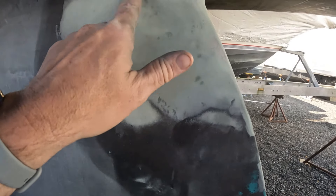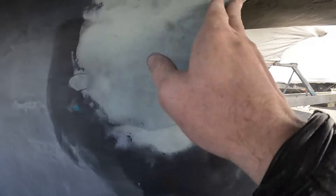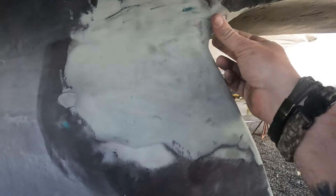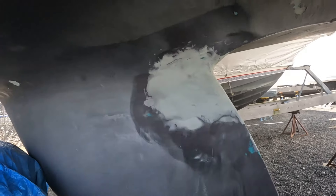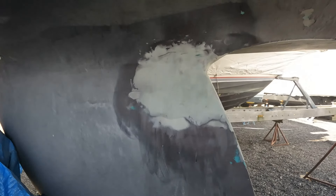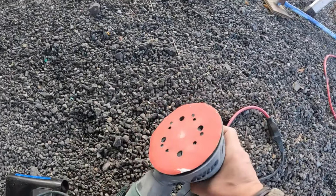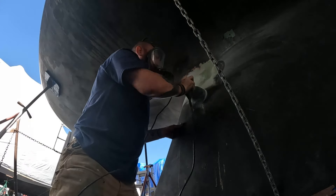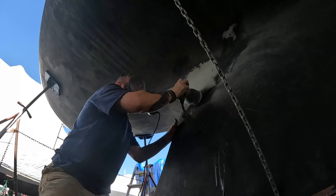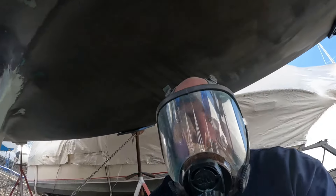I still have a little bit more here — I can see some low spots which I might just fill in with paint. What I was doing is rounding and shaping. Where all that extra material was, I'm doing a little bit more right here — I can feel a little ridge, but keep fluid; you want to shape it. That's basically it. 60-grit sandpaper eats right through it with a decent orbital. Just take your time. Now I'm going to take off the pad and do some by hand to get it exactly the way I want.